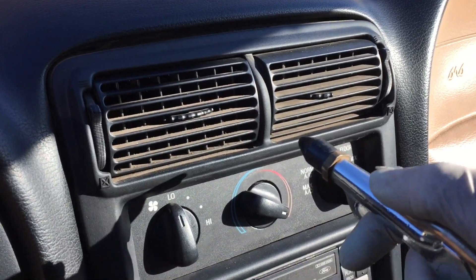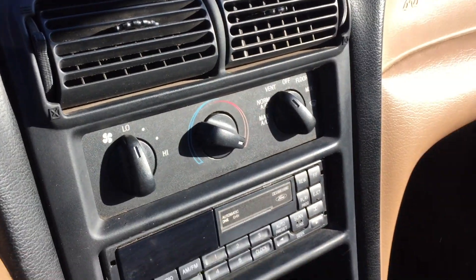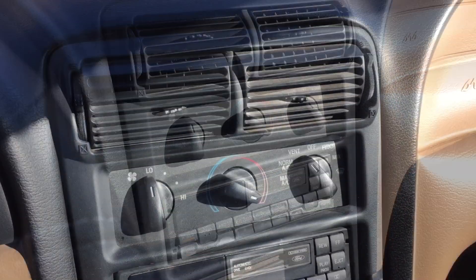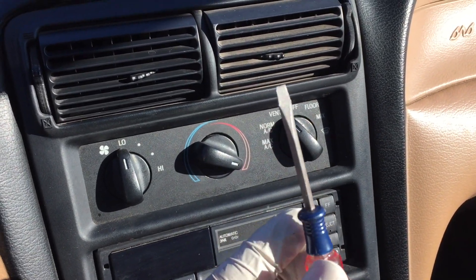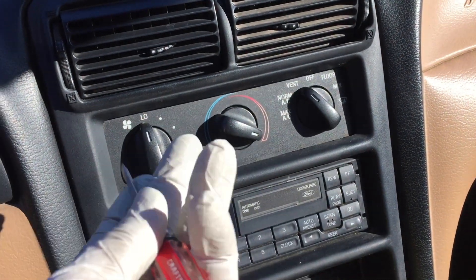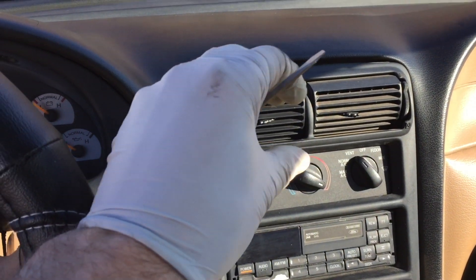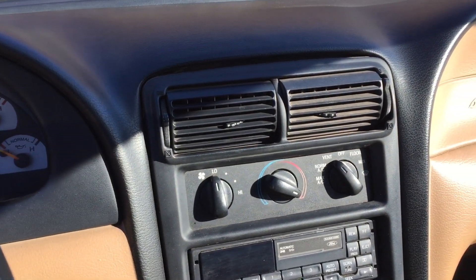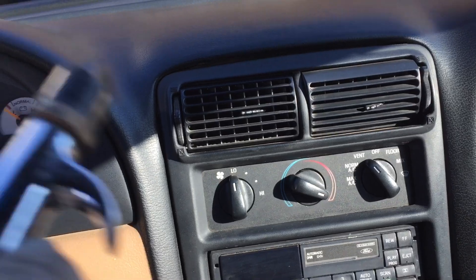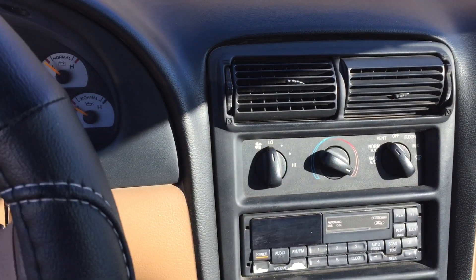Get some compressed air in here. If you ever wonder what these tiny little screwdrivers can actually be used for — get a wet microfiber, put it over the screwdriver, and just go through into the vents like that. You can see it cleans them up pretty good. You can also take these out, pop them out, disassemble them — that's another way to clean them. But for a quick way, just wrap a screwdriver with a damp microfiber and go inside the vents. And if you have an air compressor, very gently you can blow these out now that you've broken all that dust free.